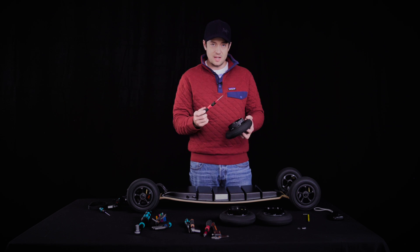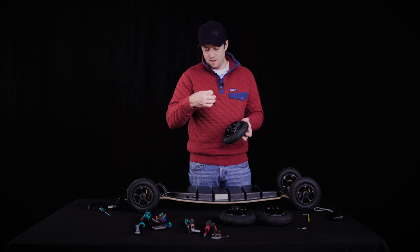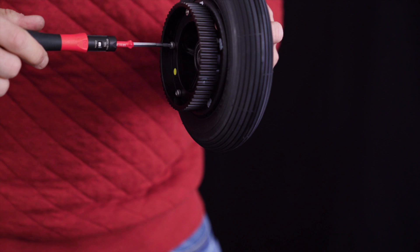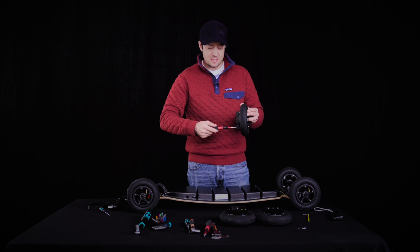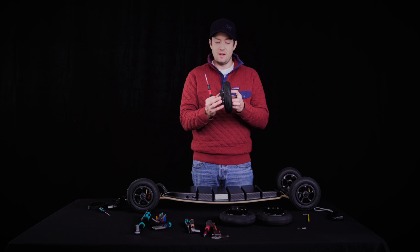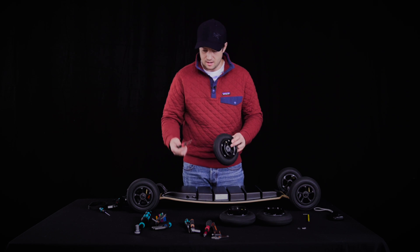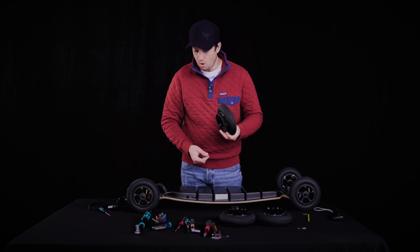The second thing is to precisely torque each and every one of those five screws in a star pattern at 0.55 Newton meters — that is the minimum torque needed for those screws to be tight. By applying equal pressure on all five bolts, you ensure even pressure that won't create wobble at high speed. So: same torque on all five screws, torqued in a star pattern with the centering jig, and you'll eliminate 90% of the wobble.